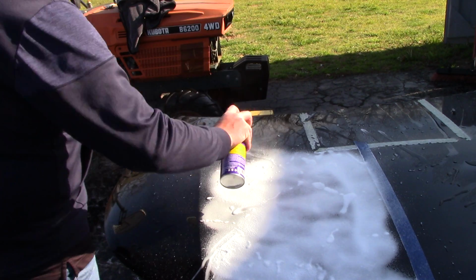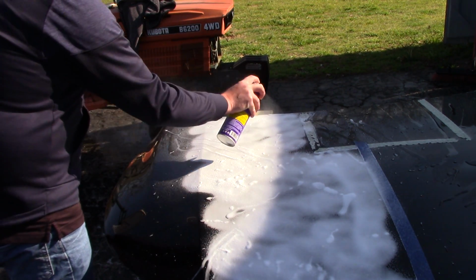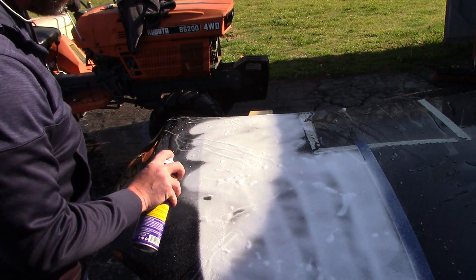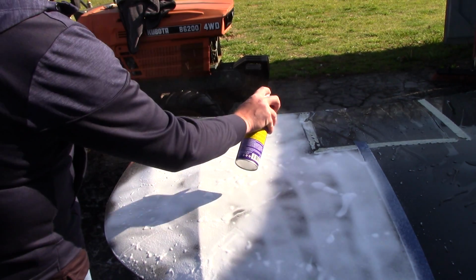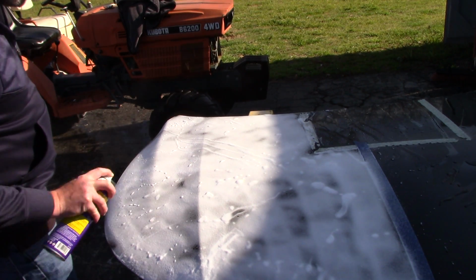A lot of juicy goodness. If you prepare the surface properly before putting Armor on, wash your car, clay it, and then use a paint prep like Duplicolor grease and wax remover. You want to make sure the surface is absolutely virgin clean. You don't want anything else on the paint.